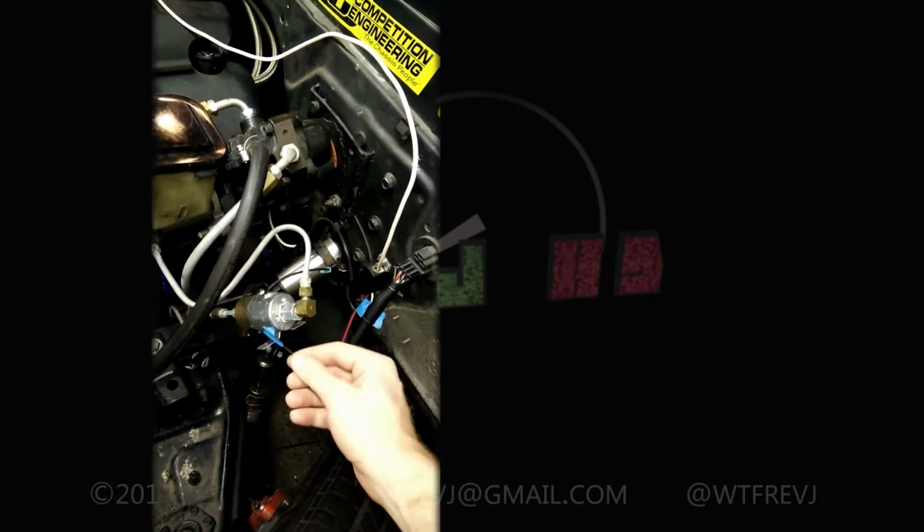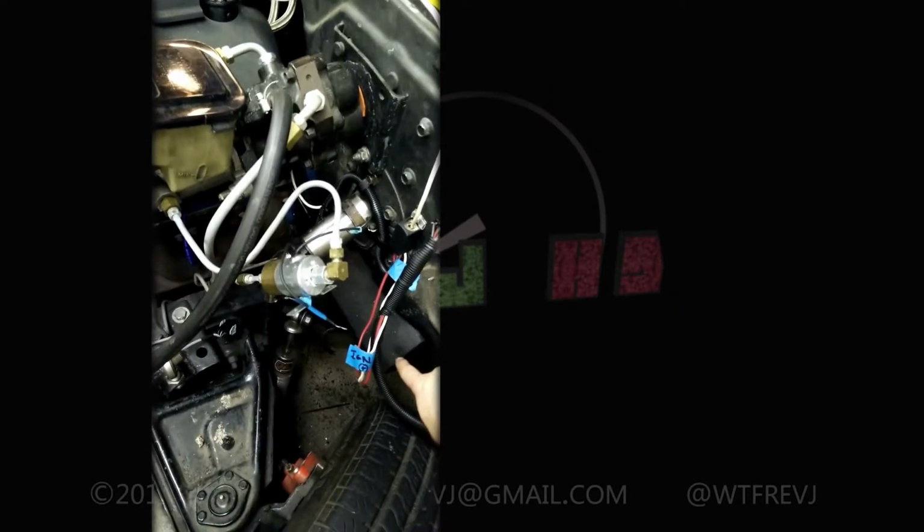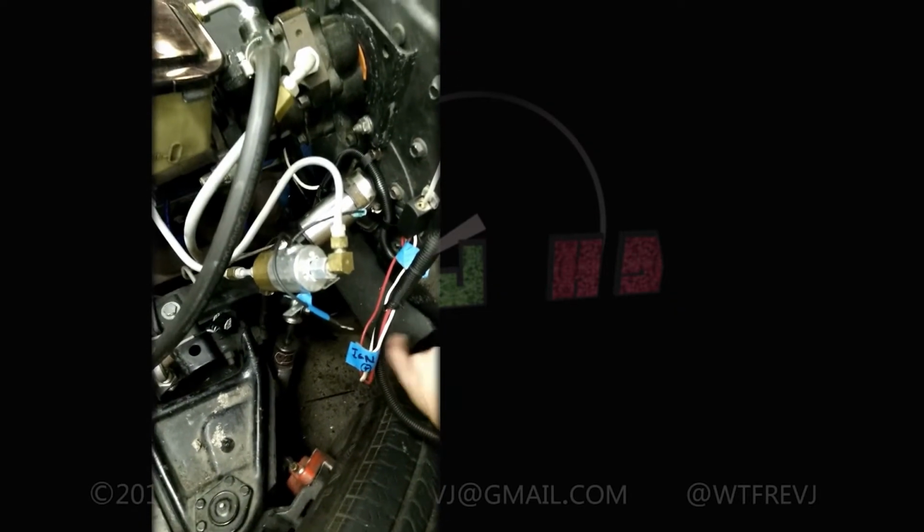We already have 2 relays in the inside for the high and low beams. If you can see here, there's the new twisted pair wiring all the way from one side to the other. We did end up putting in all new headlight sockets and redoing the wiring from there. Couple loose wires still. I've got a power feed over here. Have to hook up the ground from the line lock, which is now kind of hanging midair here since there's no inner fender anymore. You can see this little guy behind us, and you're probably wondering what that is.